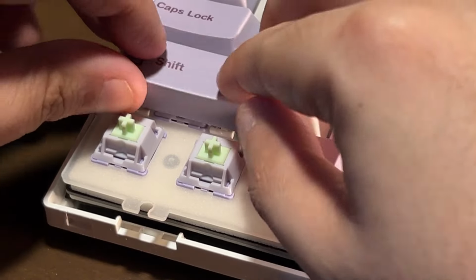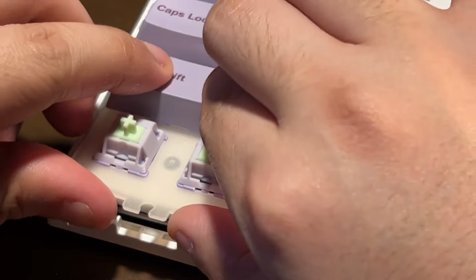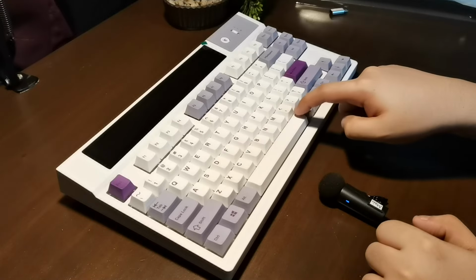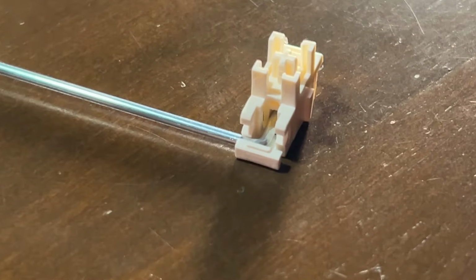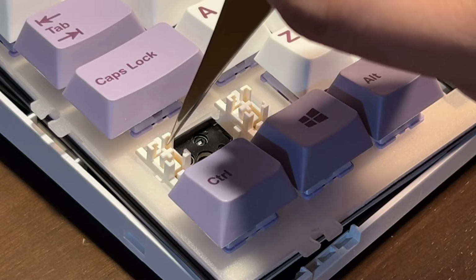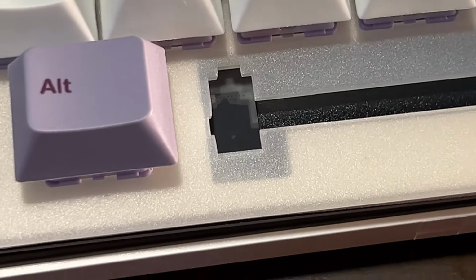This has a cherry keycap profile made with PBT plastic. Stabilizers are pre-lubed and have very slight rattle to them, so I would add more lube, especially on those bar elbows where steel touches plastic. So far, the stabs aren't loosely fit on the plate, so that's good. Glad that is the case since the PCB does not have screw-in ports for screw-in stabilizers.